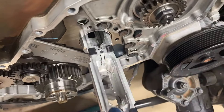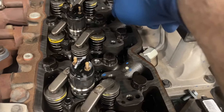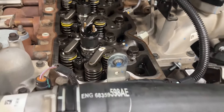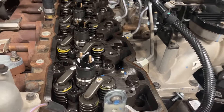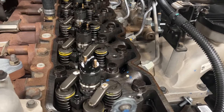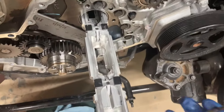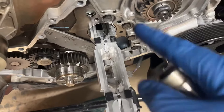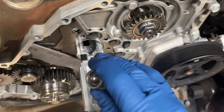There are two orientations. When you think about the Cummins motor, you have intake and exhaust. Chrysler specifies to do exhaust first. If you have the engine out of the truck you could do whatever way you want, but the idea is to do exhaust first since it's in the back. So for exhaust, think of the same thing — intake and exhaust — so the lifter has to be flipped up in a certain way to get it up in there.